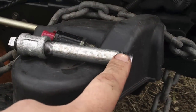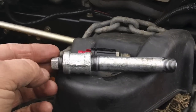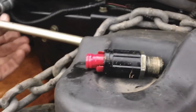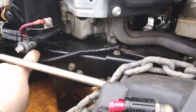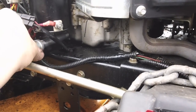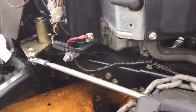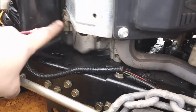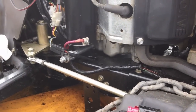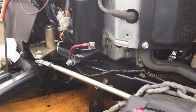Alright, so here's the assembly: 4-inch galvanized pipe, 3/8 coupler, and a 3/8 plug. That's perfect — absolutely perfect. That will fit just in there just like that, and you can drain the oil right out the side here. It is much better than the factory design, which drained the oil back under the block and over the PTO. So I'm going to go ahead and thread tape that and then permanently install it, then we should be good — we'll fill it with oil and check for leaks.